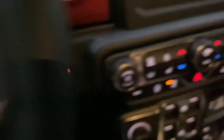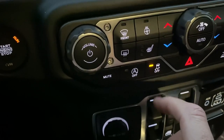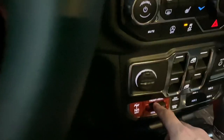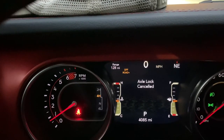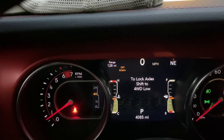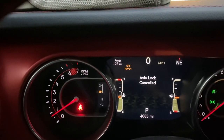What you need to do is go over to your traction control and turn the stability control off, because if we touch the locker now — if we flip the locker down to rear — it's going to say 'to lock axles, shift to four wheel low,' and then you'll get the flashing lock sign, which is not helping you out.